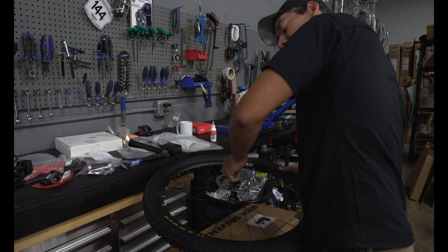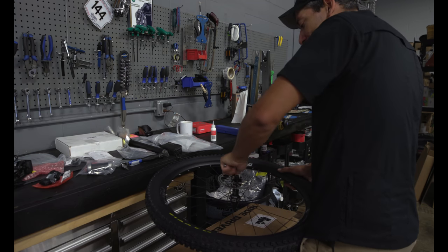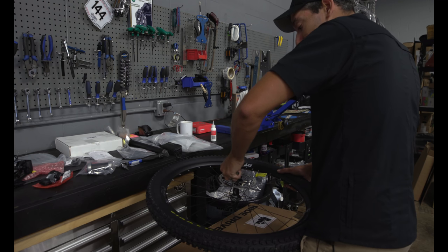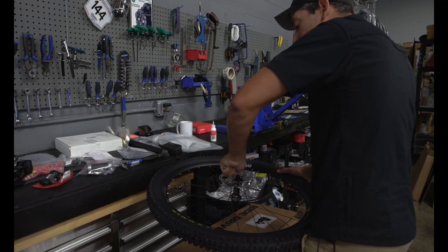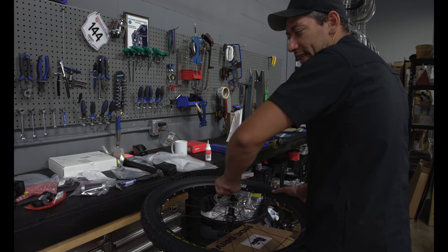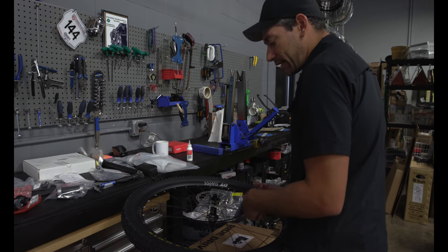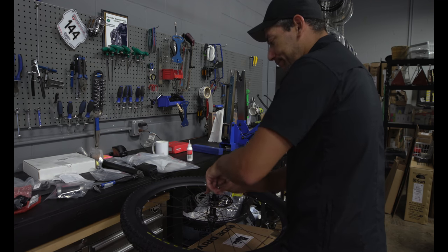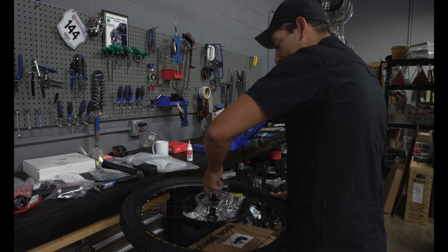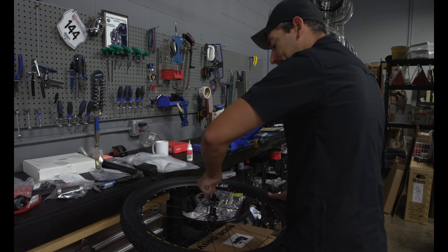These rotors, how do you know when to replace them? That's a fantastic question. So aside from contamination, I would typically say if you go through pads, you should replace your rotors at the same time. They're not like cars, where in an automotive rotor you can cut it. You can't do that with these. You'll see some discoloration, you might see some lines or grooving in them. When they're shot, they're shot. If they're terribly mangled or bent, replace them.